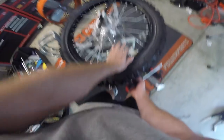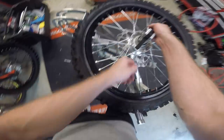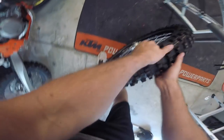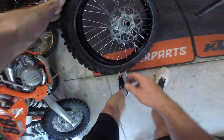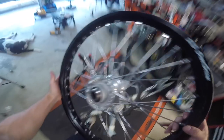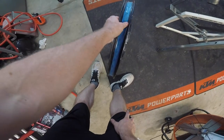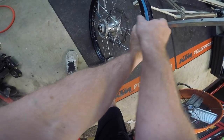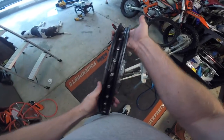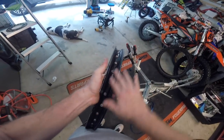All right, so we got both sides over the edge. You see how the rim is totally inside that tire there — I'm trying to do that on the bottom so I leave the valve and everything right down at the bottom and I just literally push the tire right off. Now the next step — you can see there's water and wetness in here, so you've got to remove the stock rim tape and then just really clean out. You've got to get really really clean. If there's any burrs or sharp edges, obviously you've got to take that down.